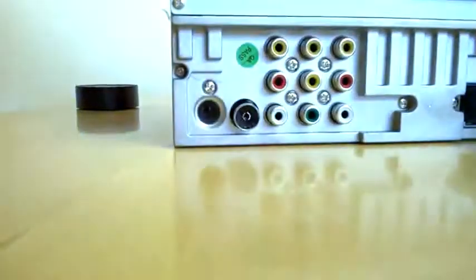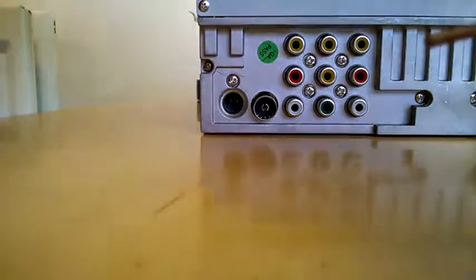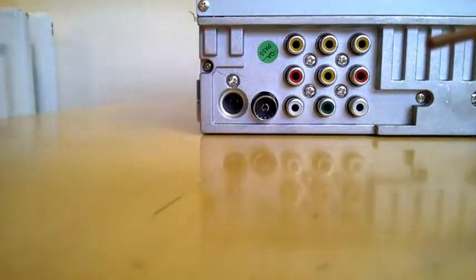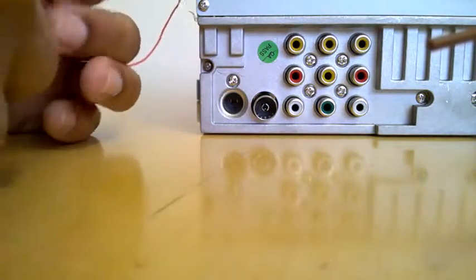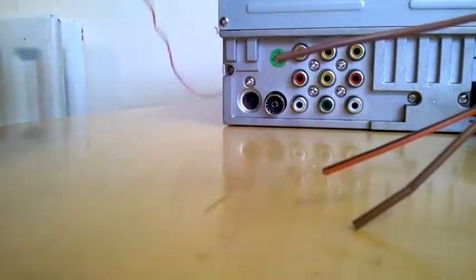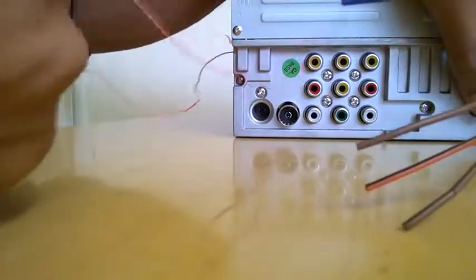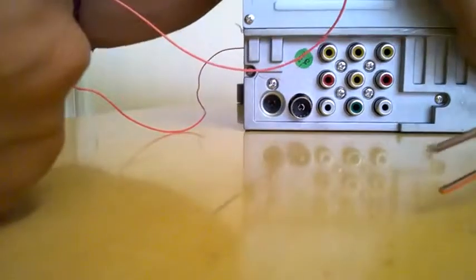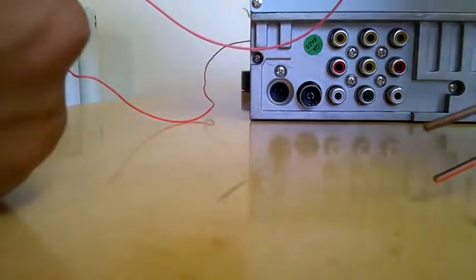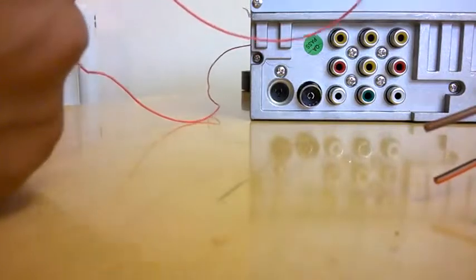I'm going to connect the unit here and connect my camera in the middle for the rear view camera. The backup camera comes with two or three wires — one positive and one negative. The negative goes to ground and the positive goes to the reverse light. The pink wire from the head unit also needs to go to the reverse light. On some cars, when you turn the ignition on the camera will turn off because the power isn't stable, so you need a relay. I've connected a relay to keep stable power to the camera. I'll just connect this to the reverse light and see if it works — if not, I'll remove the relay.